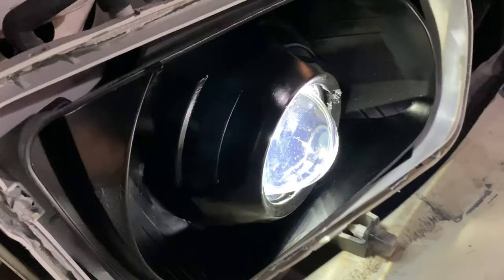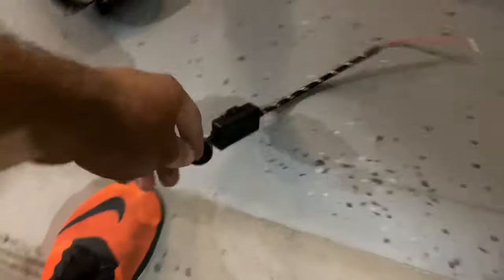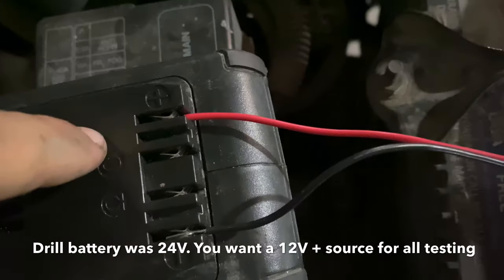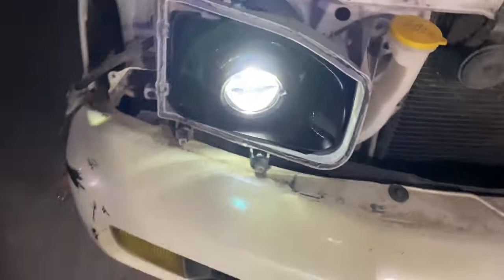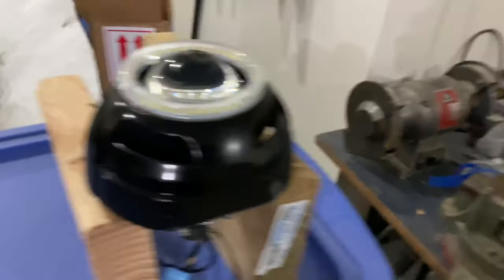You can see I've got them all hooked up, shroud popped on, wires coming out the back. This is the LED driver — it's a separate piece that screws onto what comes off the projector. I'm wiring it to a 12-volt source — in this case a drill battery, positive and negative — to power the halo and check that it sits just right. The left side isn't rubbing paint at all; only the right needed a little bevel. Both lights are now all siliconed up.